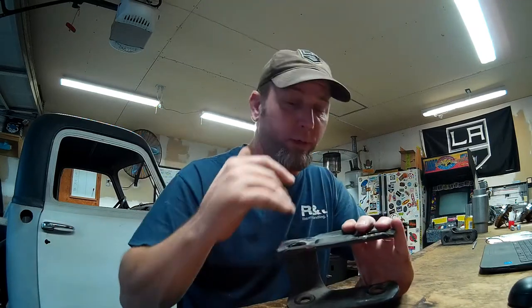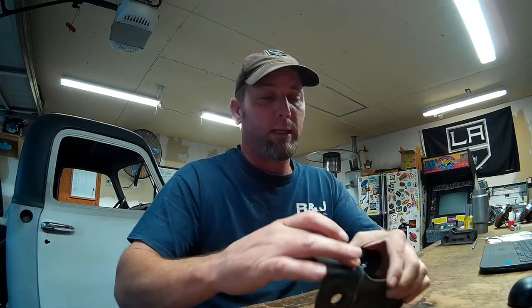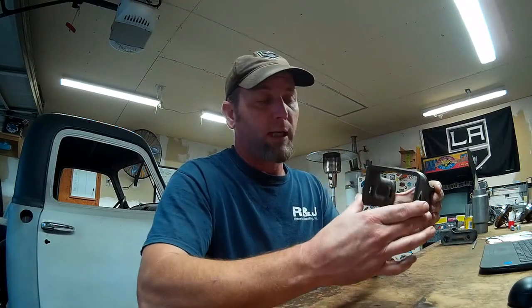I've marked the old shackles with a rough line where I'm going to cut them. I'll take my angle grinder with a cutoff wheel, cut around the corner, take the lip off the top, prep them out, get them ready to weld in, clean up the frame, locate them on top of our leaf spring shackle tight against the frame, clamp them in place, double-check my measurements side to side and front to back, and weld them in.